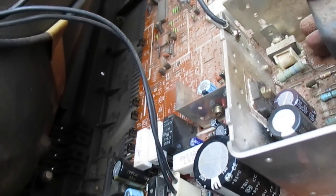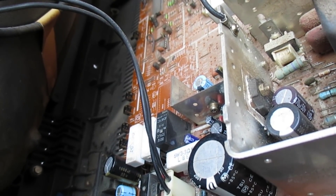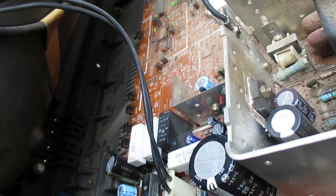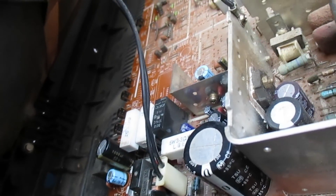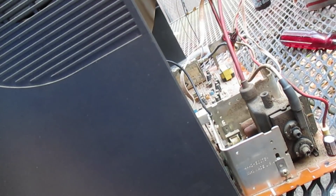I was hoping for an easy fix, but you should always check your basics first. I can't tell you how many times I've seen guys — and I've been guilty of it myself — dive right into a TV without checking the basics, and then wind up chasing your tail. Go back and check the basics and find something you should have caught two minutes after pulling the back off. I just felt the resistors in the standby circuit and they're both rather warm, so something is drawing current through them. The problem does not appear to be in the horizontal output stage or the main power supply — so that's a relief. It's something in the standby power supply.